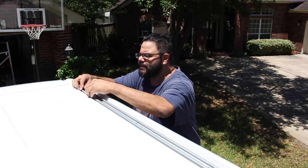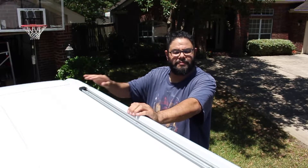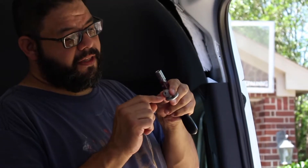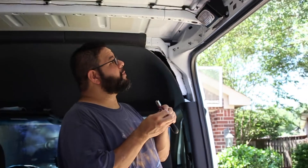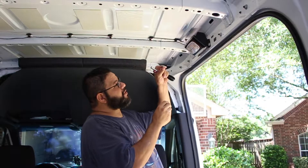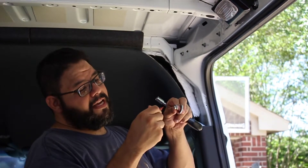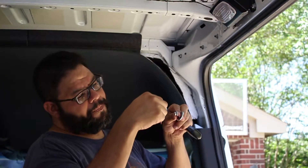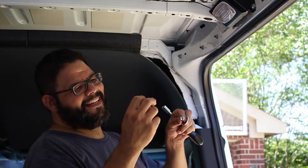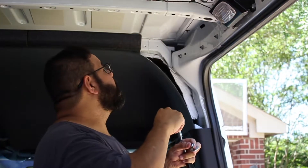When we go to tighten it up, we're going to tighten a little bit at a time — one bolt a little bit, then the next — that way we get an even tightening. I really like the idea of having these rails. Eventually we can put a roof rack up here; for now it's mainly going to be to mount our solar panel. The kit comes with a washer and a flange nut — the nut actually spins on the washer. I'm going to put more butyl on the outside here and make a cone just like I did on the top, so the washer will squeeze that butyl between. Before I put the nut, I'll use the blue Loctite. Then I'll torque it down, slowly going through each one.